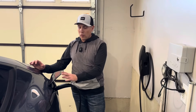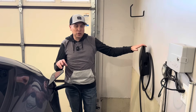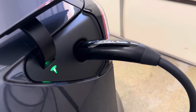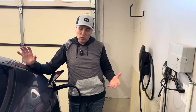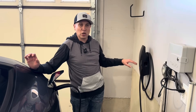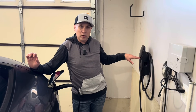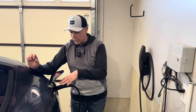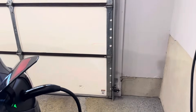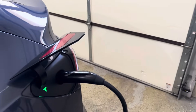I'm in the garage and the car has been plugged in overnight. One of the things I've always talked about in my previous videos is the ABCs of charging — always be charging, always have it plugged in. This is the Tesla wall connector. I have two of these in my garage, one for each car. This does not actually charge the car — the charger for the battery pack is inside the car. This wall connector is just a fancy extension cord giving 240-volt power.